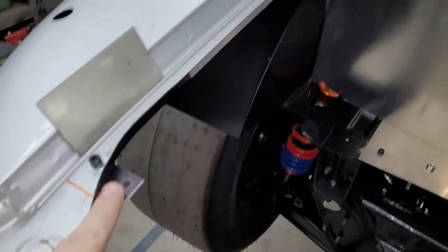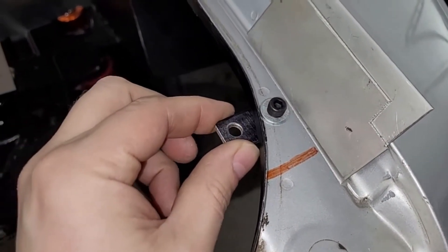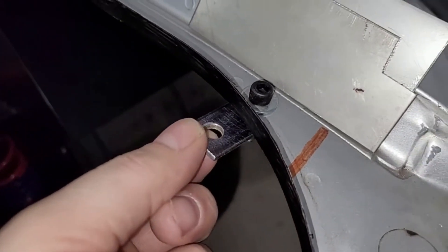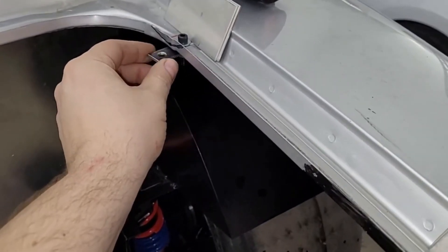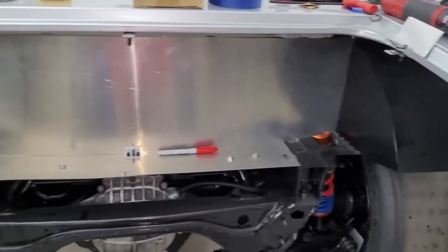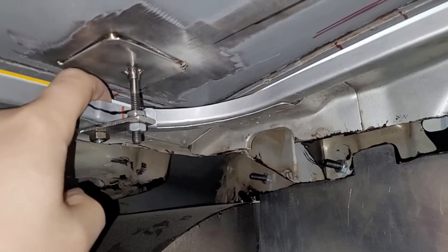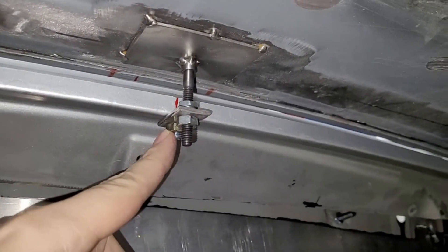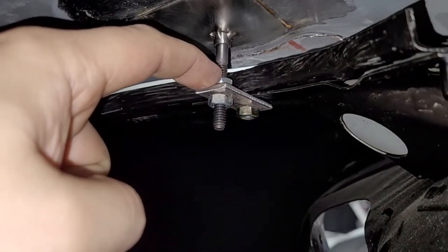We measured our tabs, calculated the numbers, got them cut out, and they're roughly installed - slightly loose. If we come to this one, you can jiggle it a little; the holes here are quarter inch but the mounting holes are five-sixteenths, so it gives a little room to move, and of course they can swing. With all that adjustment, we should be able to get the trunk lid lined up. And of course we do the up and down with the bolts. We got our brackets put in - this actually went pretty much how we expected. The only thing was we had to change these bolts out for hex bolts because we couldn't access the top to hold a socket head cap screw to tighten the nut. We've got a lock nut on top and a regular nut on the bottom.